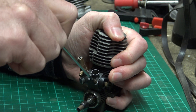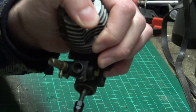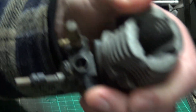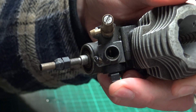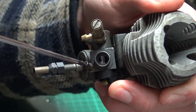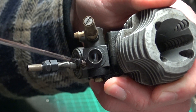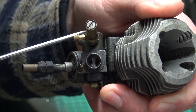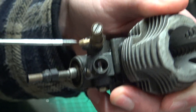You've got to make sure that your throttle's in the right place for it to screw in, otherwise it won't go in. Hopefully you can see — the throttle's moving. That's wide open, and that's closed, or would be a tick-over. I'm holding it on closed — I'm not going to move my finger. If you watch, I'm undoing the screw. The throttle is now closing all the way. So this would be no tick-over — there would be zero tick-over here. It hasn't affected the tune on the low-speed, mid-range, or whatever needles you might have, or the high-speed needle. There's no effect on any fuel whatsoever.